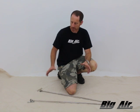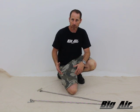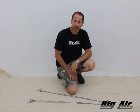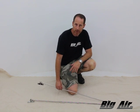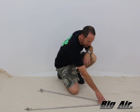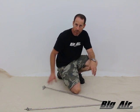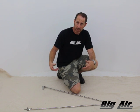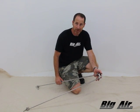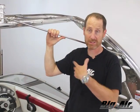Let's talk about our LSB system used on the Wave Tower. The Wave Tower is a forward-swept tower, and because of its size, we want to make sure it doesn't move side to side — that's a big issue with cheaper or inferior towers. We use a unique triangulated stability device with turnbuckles: a stainless top piece goes over the head of the tower, and the turnbuckle tension rods extend out to the ribs on the interior of the legs. They won't be in your way and bring the system into tension. It's all stainless, and it delivers incredible results for the Wave Tower.